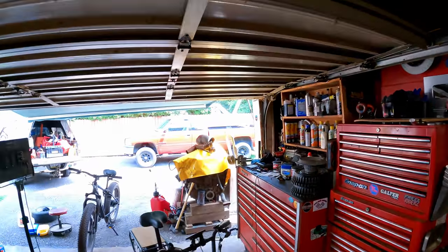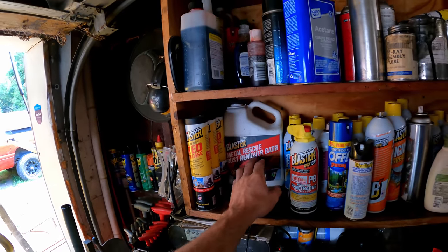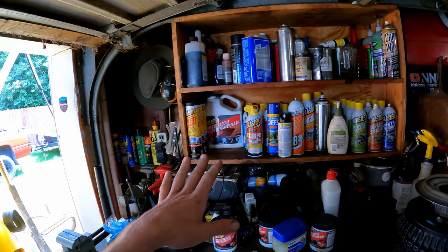We're now several weeks later. Unfortunately the Blaster didn't do the trick — as you saw, there was super heavy rust in there. I used Blaster Metal Rescue, which works wonders on heavy rust even better than vinegar. Poured it into the troublesome cylinders, ate away the rust, but still could not get those pistons to turn. I even poured some diesel in there and went back probably eight times checking this thing — the motor is still locked up. I am ready to throw the towel in on this one. However, if one of you guys is interested in this Ranchero, they only want $650 for it. This motor still has potential — you'd probably just take the heads off, scrape off some of that rust with maybe a ball hone or sandpaper, then tap each piston using a 2x4 and a hammer to get them broken loose. I think that motor would run again — it'll probably smoke, but it'll run.